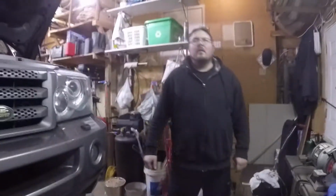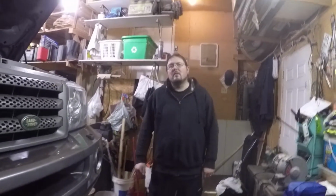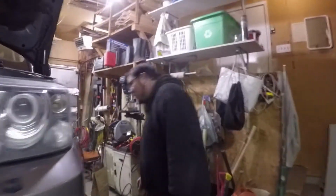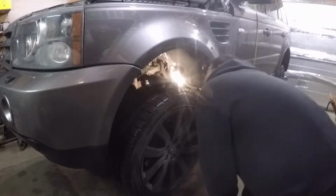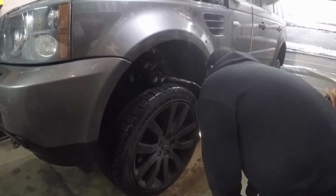Short of that, what else could knock? Maybe suspension. Since it's hydraulic, I don't know if something can knock within that suspension on the inside. For your bags? Yeah. Not impossible. So upper control arm? Yeah, exactly. That was my next step. Is it either the bag or the upper control arm? But you'll see that once we remove the wheel, we can easily move the lower control arm. You can see that the back bushings are definitely super loose. Okay. So I'm assuming that's what's making the noise. It's very soft, yeah. So we have that.